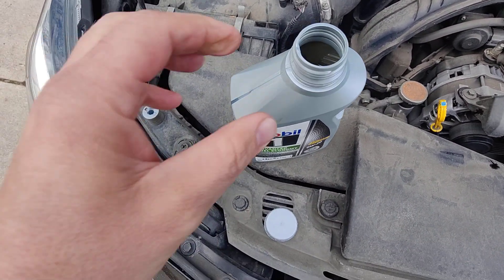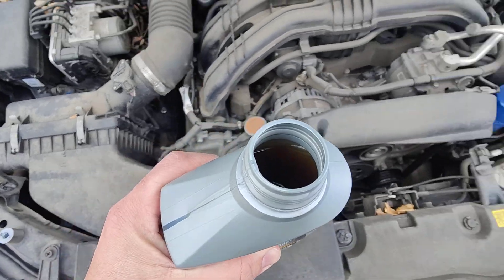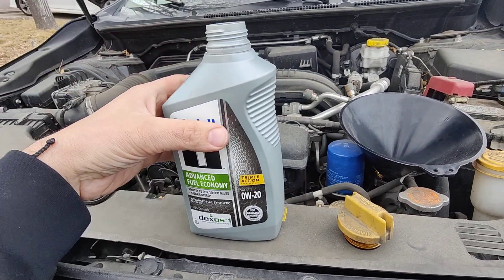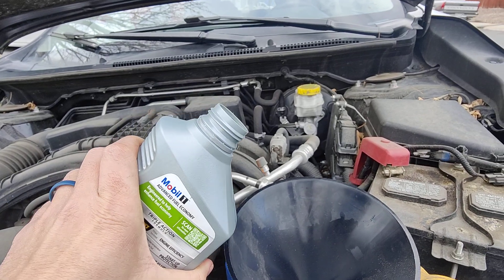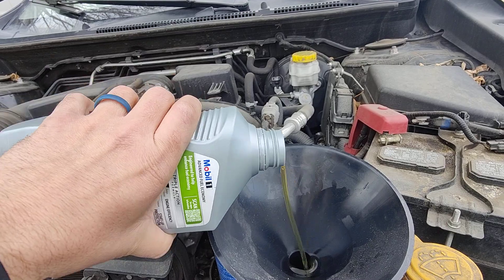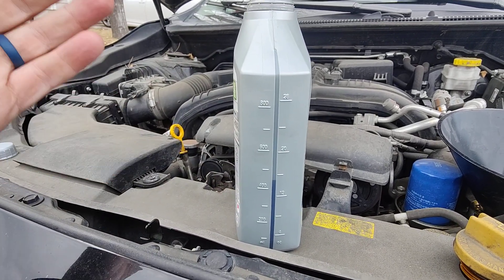When you open the lid, make sure there's no foil or ring that could come off and go into the oil — that's also a nice thing about using the funnel. One thing is that oil bottles are designed to pour this way, so air can go in from the top and you don't get it gulping for air. So I'm still going to add about half of this to get started and then check it — a little bit more than half — but now I'm going to run the engine and then check it again.